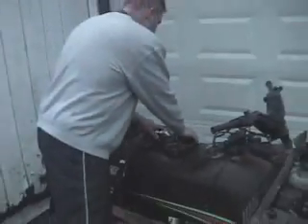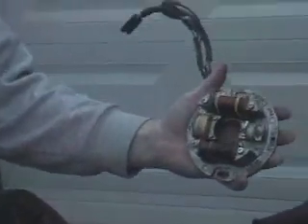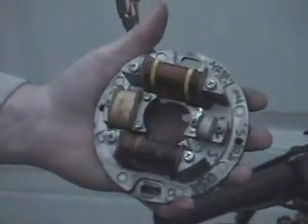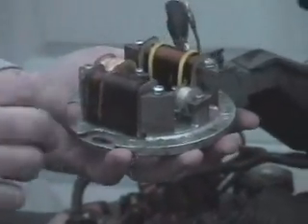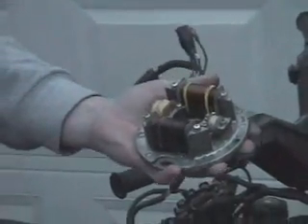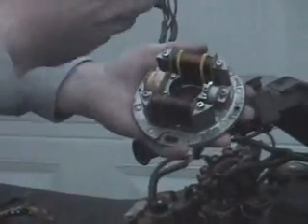This particular snowmobile — a 94 Arctic Cat Cougar 440 liquid — has a little bit different stator. It looks different than a lot of other stators, but again, you look at it and you've got the two large coils with large gauge wire. This is what your AC power is coming from — that powers lights, gauges, and so forth. All stators put out AC power: AC power for your lights and also for your ignition. There's no DC power coming out of the stator itself — all power is AC.